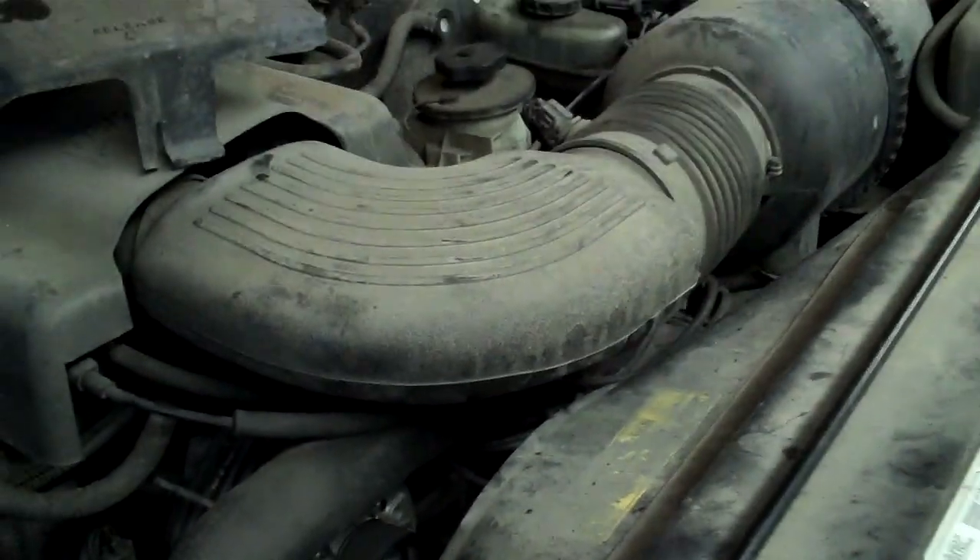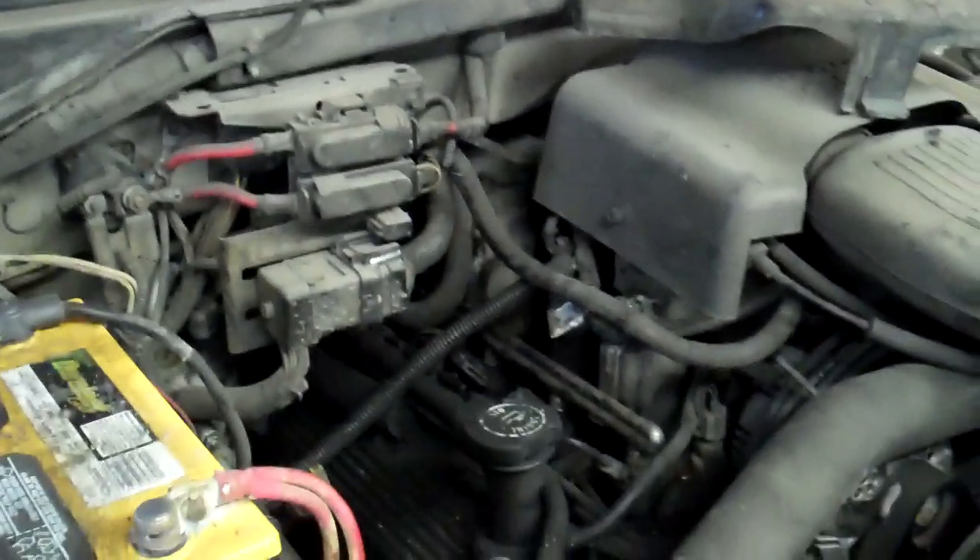I don't remember the last time my hand was that dirty — I always wore gloves. You can't feel it with a glove on. Anyway, this is a '98 Expedition. It's something to look at — if you have one, I'd maybe move that wire harness so that it doesn't rub on it. But if the engine were kept a little cleaner it'd help too. It's just like a really fine sandpaper because everything's covered in dirt, so even plastic with some dirt on it — that's what rubbed through it.